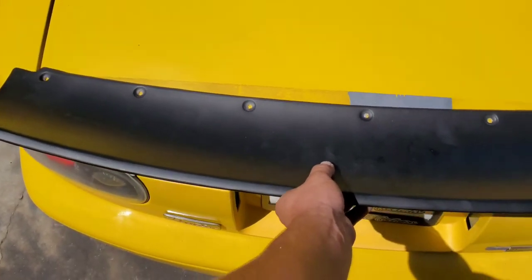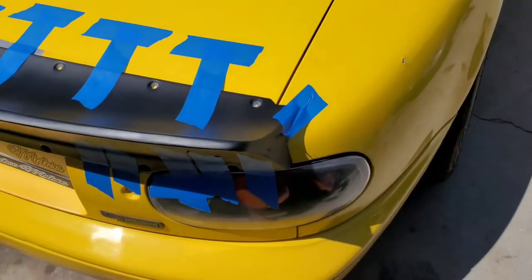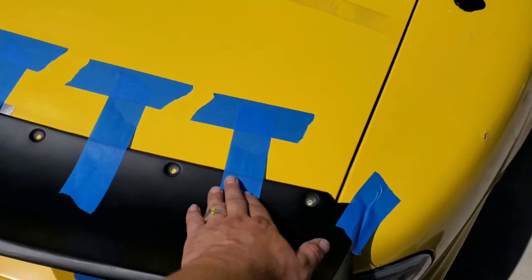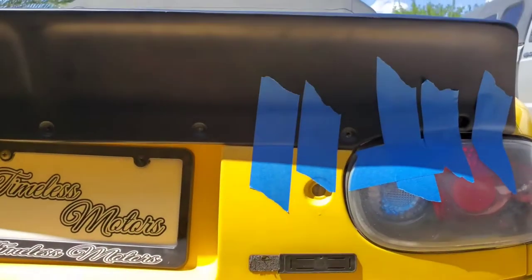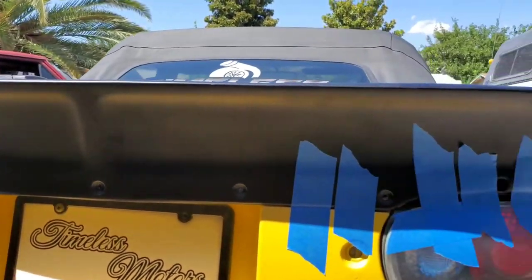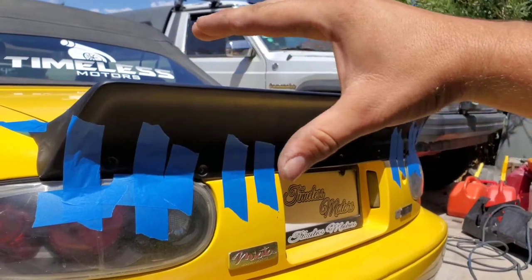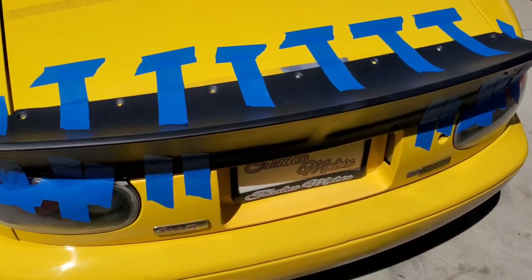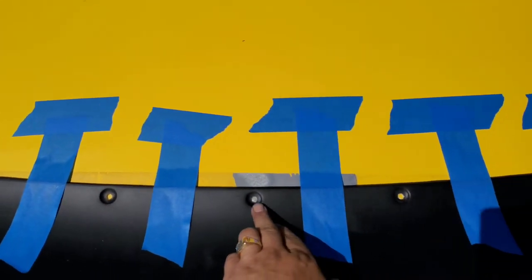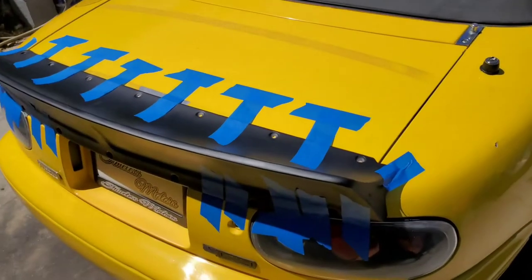Let's tape it up, mark the holes, and get drilling. As you can see we have the wing all taped down. I centered it right here in the corners first, then taped the top and reinforced it with some cross tape because I had to press down to get it to fit nice on the back. There's actually a lot of pressure pushing in on the wing to expand it and make it fit, so it's sitting nice and flush. I like its position, so we're going to drill our quarter inch pilot holes, remove the wing, then step them up to the Q size bit and insert our rivnuts so we can bolt it back down with the hardware.